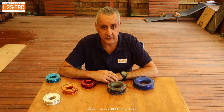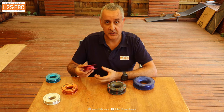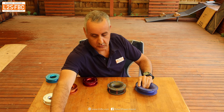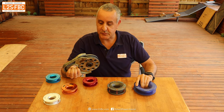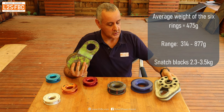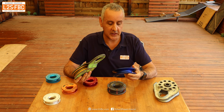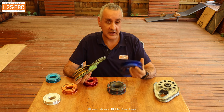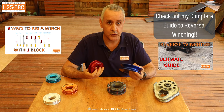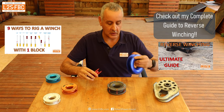Size and weight — obviously you want these as small and light as possible. Most rings are around 320–360 grams; the lightest is around 314g. The Saber is the heaviest at 877g, but that's still a featherweight compared to the ARB snatch block at 2.3kg, or over 3kg for heavier steel blocks. You could carry three snatch rings for every one steel block, lighter and taking barely more room. Since they're now quite cheap, I recommend carrying two, three, or even four to enable creative winch rigging configurations.